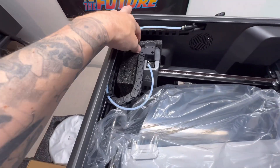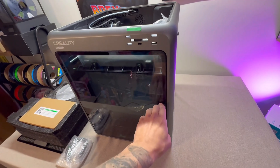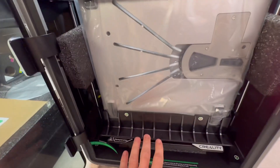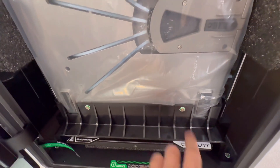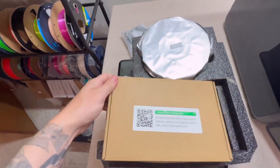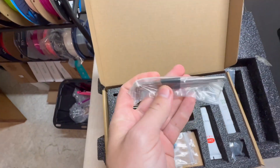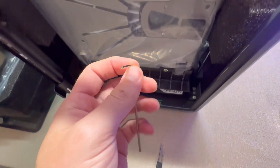Pull out this little piece of styrofoam in here — it's kind of tough to get out. Then open the front door and remove these brackets. It looks like there are four screws, and these little screws require Allen wrenches. Come over to your supplies and open up this box to find the Allen keys. It is the third largest Allen key.